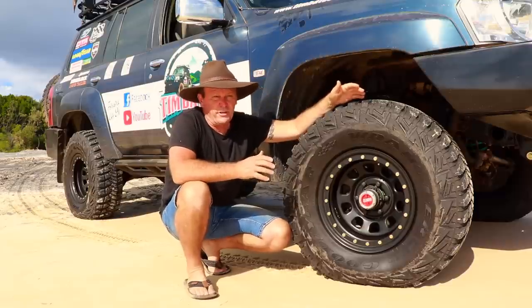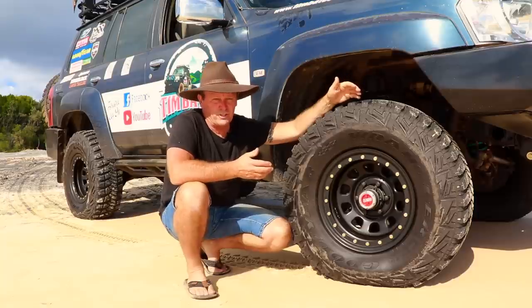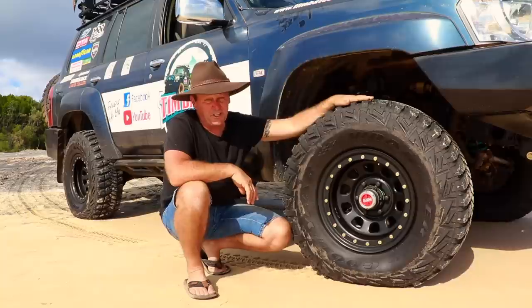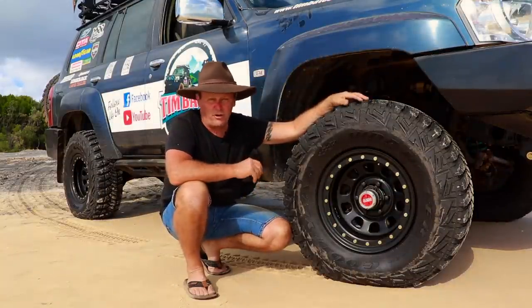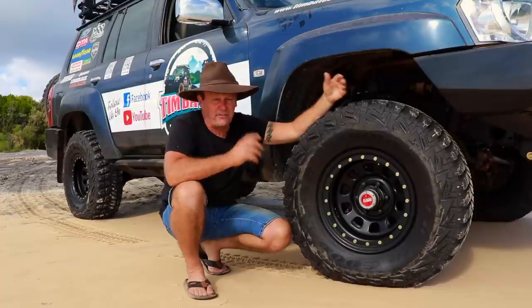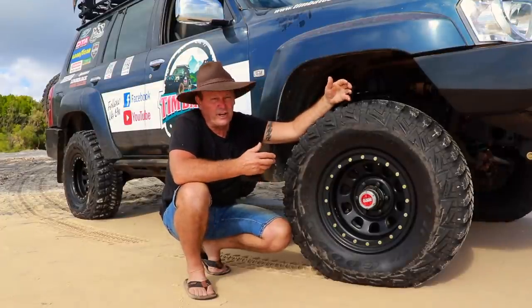If you're going to start with a tire, you'd probably want to look at an all-terrain tire or an aggressive all-terrain tire. But I've got the full mud tire on here. This is probably the least suitable of those three options if you're going to do a lot of beach and sand driving, because of the big open tread blocks — if they start spinning, they're going to dig into that sand very quickly, as opposed to the aggressive all-terrain or even your all-terrain.